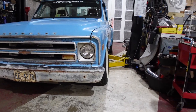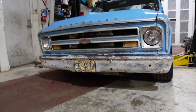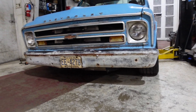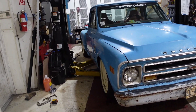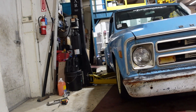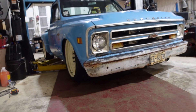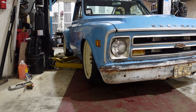It's kind of hard to see how different it is, and we just raised it up and down so the suspension isn't completely settled yet. But you can see how much camber this side has. I raised it up probably four inches on the coilover and it still needs to go up three or four more inches — it's very low. It literally was just sitting on the fender. The camber definitely is a little bit better and probably could be even better if we raise it up some. It looks cool but it's completely unfunctional and would probably blow out the CVs. So I'm going to keep raising the coilovers up until we get to a functional ride height.